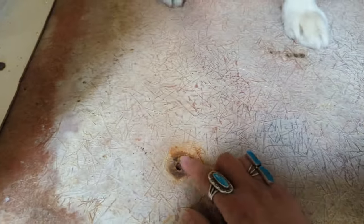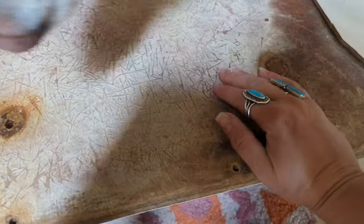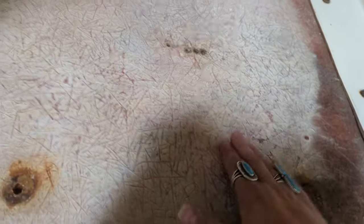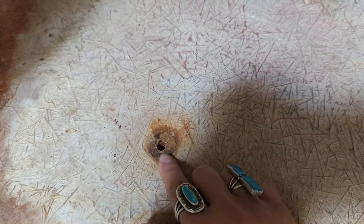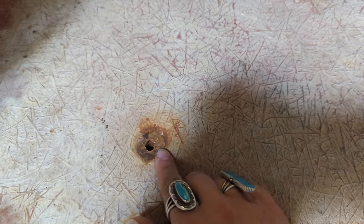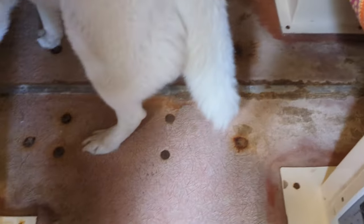You can see the elevator bolt we took out — that was the easiest one to get to. Because of the water damage the fiberglass looks a little wonky and is all soft; we're going to have to replace and patch that area with a fiberglass patch. I don't know if these were as badly rusted when I first got the camper — I didn't think they were — but now I'm seeing how badly all those spots rusted out because somehow water got in.